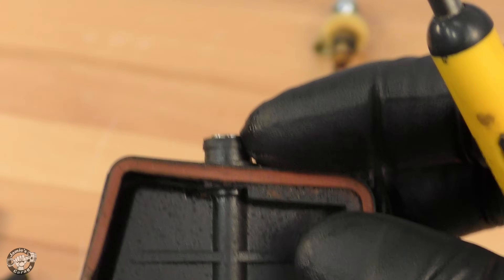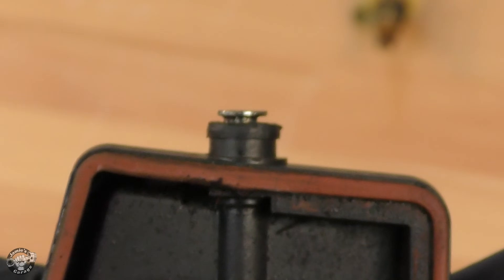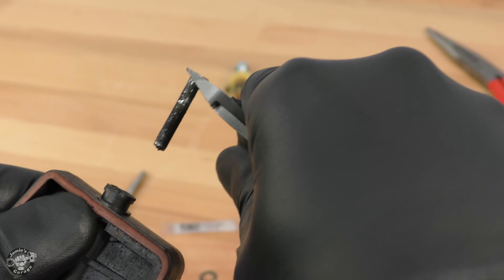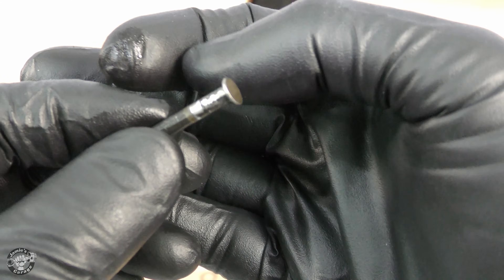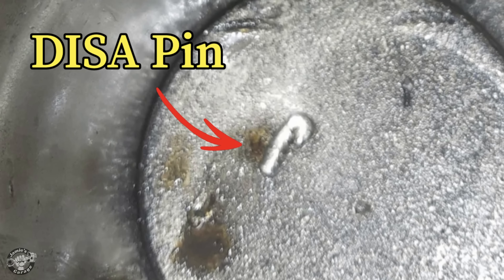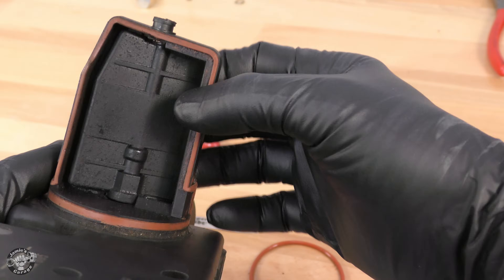The next step is to remove this pressed pin by wedging a screwdriver between the housing frame and the end of the flap, and gently prying and twisting until you see the pin start to extract enough to get a thin pair of side cuts in there so you can pull it the rest of the way out. This little guy right here has fallen out and ruined many engines, but not on my watch, not this time. Now that the pin and bell crank lever are removed, the flap basically just falls out.